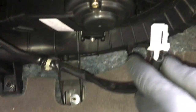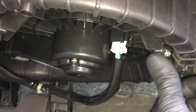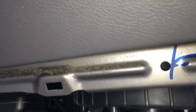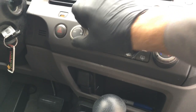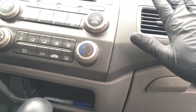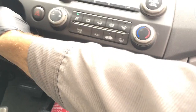Now that the screws are re-secured, plug in your electrical connector. These are all just snug — you don't need them super tight. Now turn the car on and check your fan and blower operation. When you check your blower operation, you just want to make sure it works in all settings: full high, then cut it down a couple notches and check it. Once you're satisfied that everything is working, we can go ahead and put the lower cover back on.